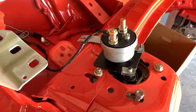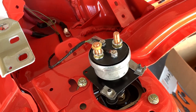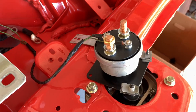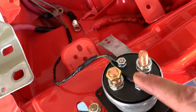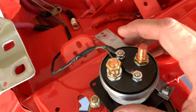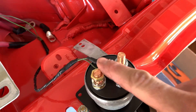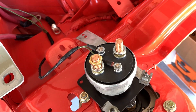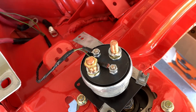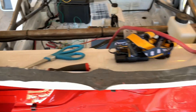The issue I had on the Fox was using a standard two-post kill switch and the control pack wouldn't kill it because it was back-feeding through the alternator and kept it running. So I got this four-post one — it's the same one as I have on the Fox — but it has these two posts that I have hooked up to the ignition feed to the control pack, so whenever that's killed it'll kill everything along with the battery. It'll work out real nice. I got that permanently installed with a nice shrink wrap.